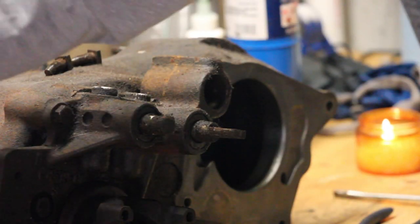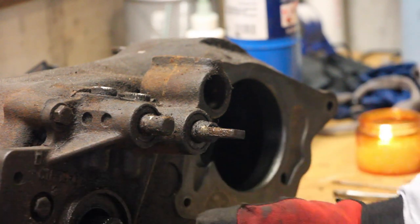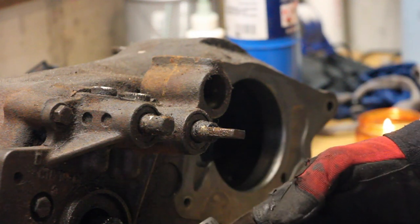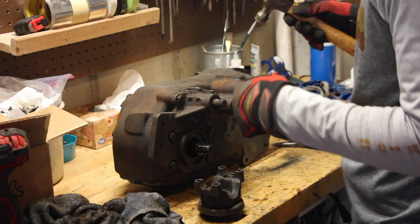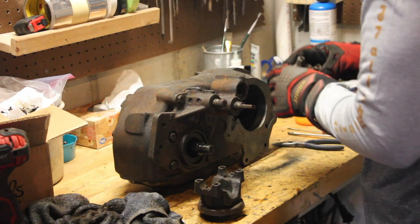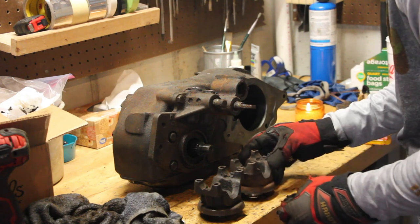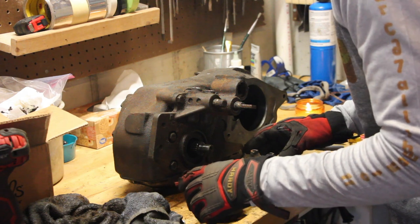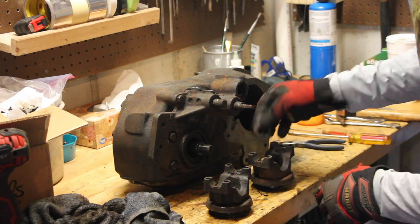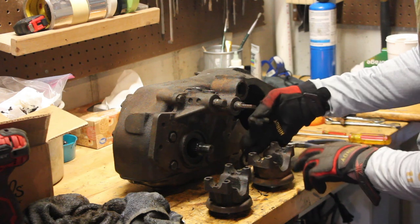The support arm operates kind of like an impact wrench - it is a hollow tube and like everything else I'm going to powder coat that. Bag and tag all this stuff. No puller needed - the yokes just come off nice and easy. Both the front and back yokes have the exact same marking: 629 dash 1 and an 18 at the top, so the yoke for front and back are identical. There is also a washer on the inside of the yoke between the mounting nut and the yoke - a nice thick washer.